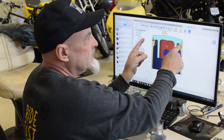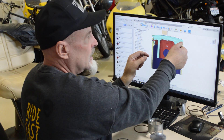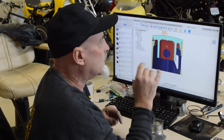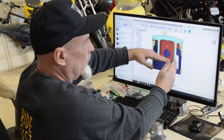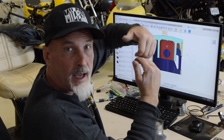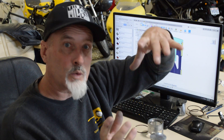I'm going to get rid of this focal point of the stresses going through this and lower it down in the piston. How I'm going to do that and still keep it pretty lightweight is going to be a little difficult, but I think we can do it. We're going to have to be a little tricky with some of the machining and do some undercutting to get rid of some of the weight. I'm going to move the threads and that focal point for the wrist pin and the energy going through the wrist pin into the skirt itself — and eliminate it. Its focal point is right where that ring gap is; that's going to be its own separate thing.